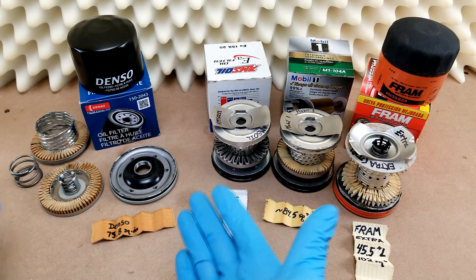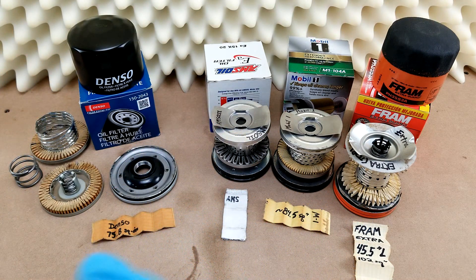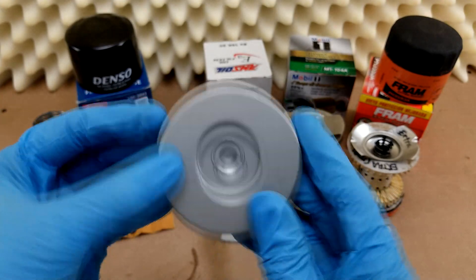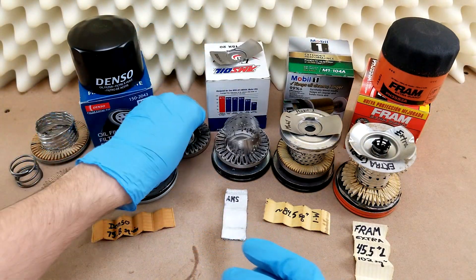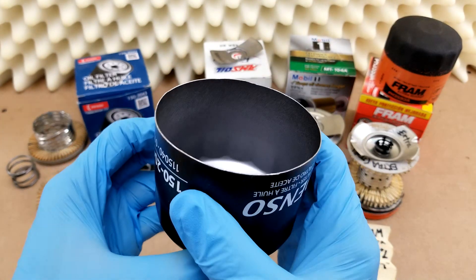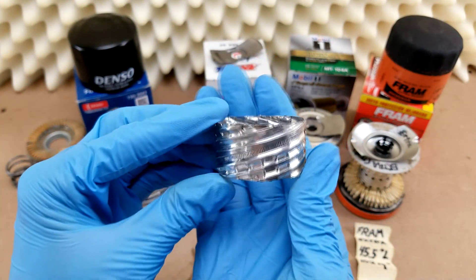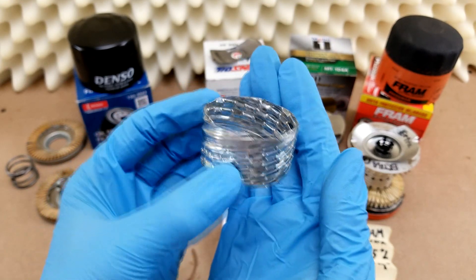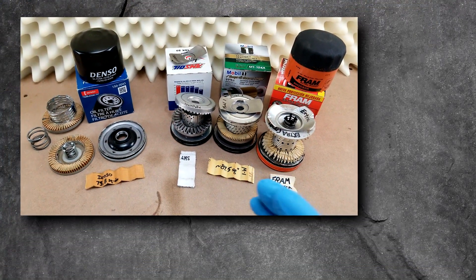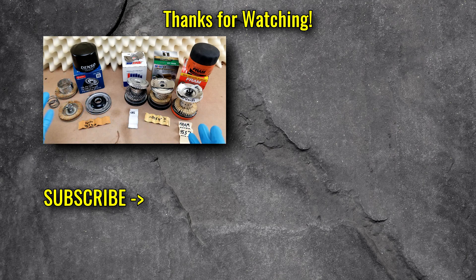I don't know what the efficiency of this filter is, but if it's good enough for Toyota and the build quality is clearly decent, then it's good enough for me. The emergency bypass valve is pretty typical; it does have a metal-on-metal seal rather than a rubber gasket like you'll see on some high-end filters like the Amsoil, but I can't get really excited about that. The case is the 20 thousandths thick steel I was expecting, and lastly, the center tube is the preferred spiral wound helical style design — and it also happens to be the largest diameter I've come across yet for these filters. That is Denso for you. If you want to see any other filters, please leave your requests in the comments along with any other questions. Thank you for watching.